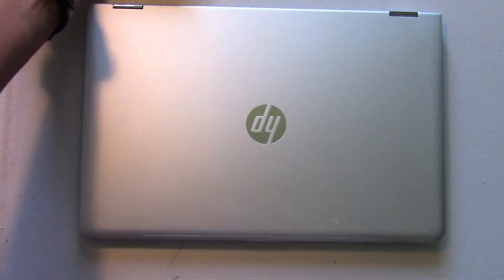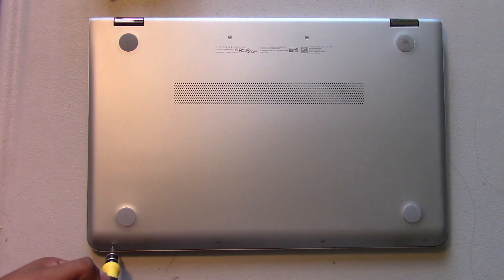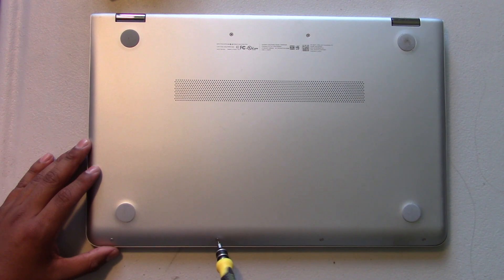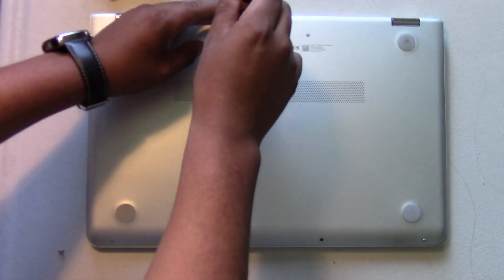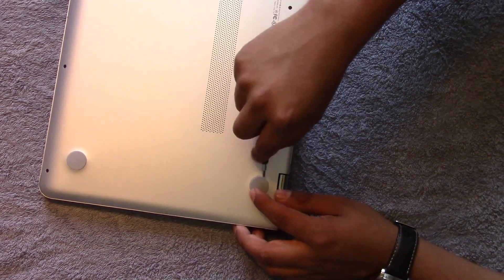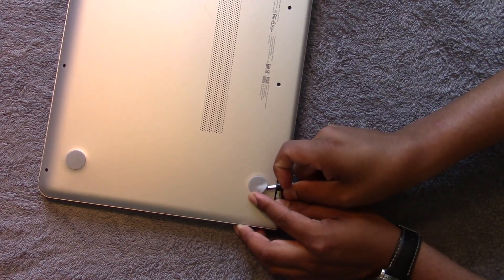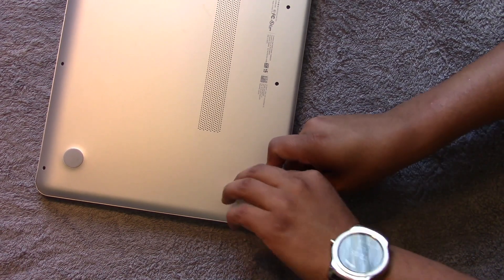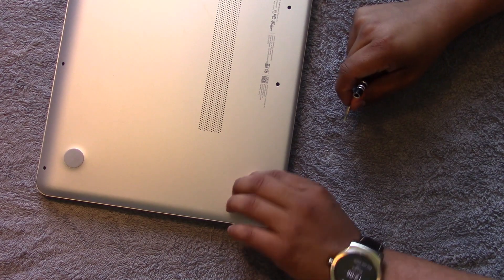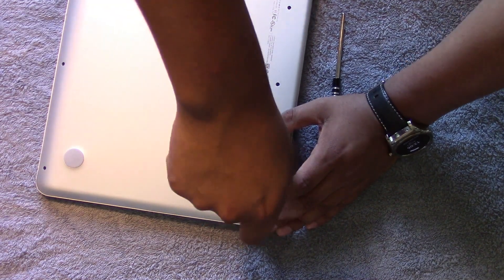Now that you're done with the cloning, we can move on to removing the bottom housing of the laptop. You'll need a Torx T5 bit to remove the six screws along the side of the laptop. Then you'll need to remove the upper silicon feet because they conceal the last two screws, which are Phillips screws. The lower feet don't conceal any screws, so don't remove those — you might need double-sided tape to stick them back on. You can remove the upper feet with a thin piece of metal or a razor blade, but be careful not to damage the bottom of your laptop.